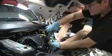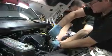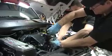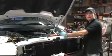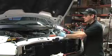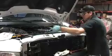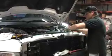Looks like we're good to go. The last and final step is to attach the air tube from the intercooler to the intake air horn — this will take just a couple of minutes, good to have another set of hands. With everything complete, make sure that both negative battery terminals have been installed securely and tightly. Then check the engine bay to make sure that all tools have been removed from the working area before the first startup.